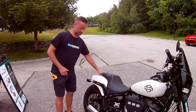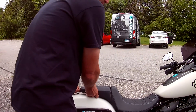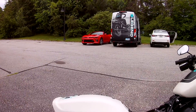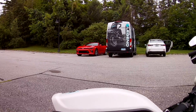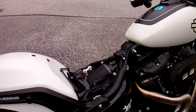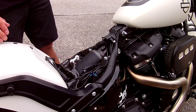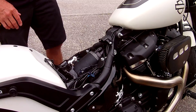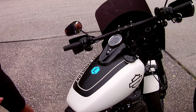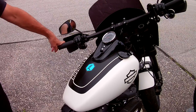Working our way to the rear of the machine, this is our new Aera mono rear suspension. This is an air ride system that fits all of the 2018 Softail models and all of the 2019 Softail models, with the exception of the FXDR. That shock replaces the entire hydraulic preload adjustable stock unit. The kit comes with the handlebar mounted control, the wire harness, the onboard compressor, the shock, and all mounting hardware needed to complete a fully functional install.